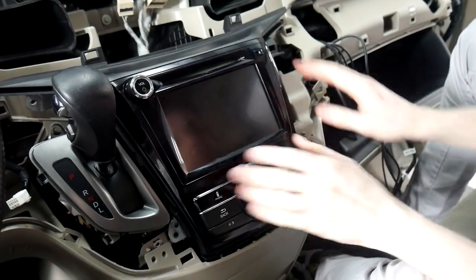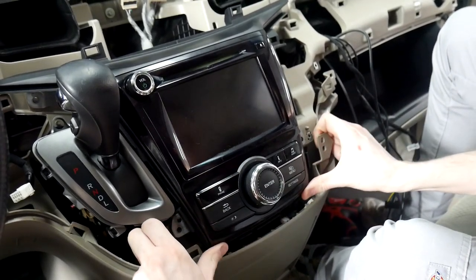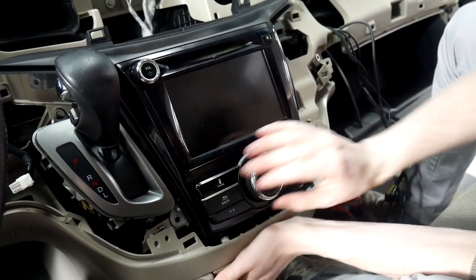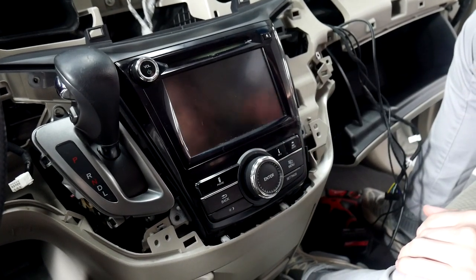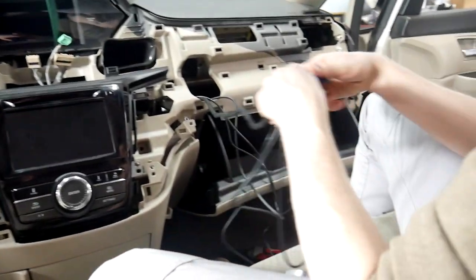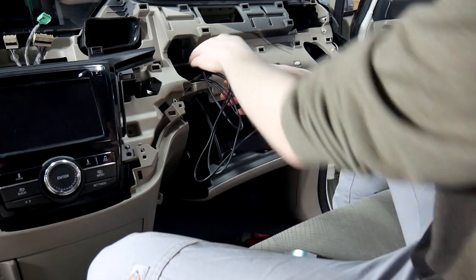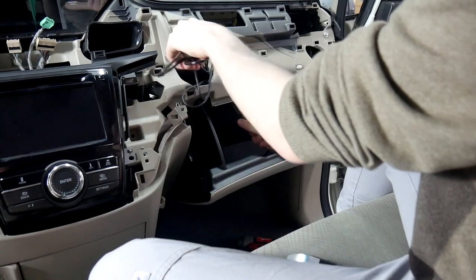With the clips on the way down here, you've got to wiggle it into place, and once it's semi-close you can pull back and line everything up. Now that it's all lined up we can pull up on this and it'll go in. We just need to line up the sides and everything will snap back into place. All the cables are ran out up here — all three of them — and we're going to push those right down into the glove box from this corner. You can zip tie the cables to the existing wiring harnesses back there to keep them managed.